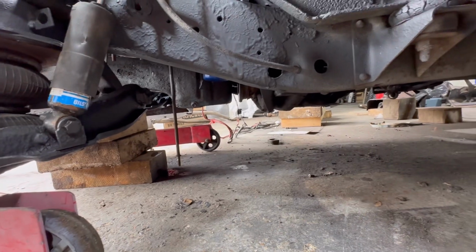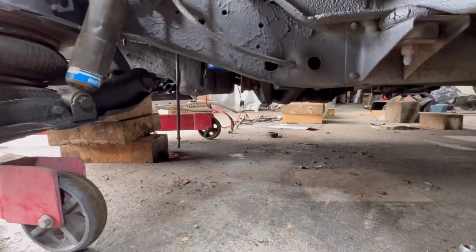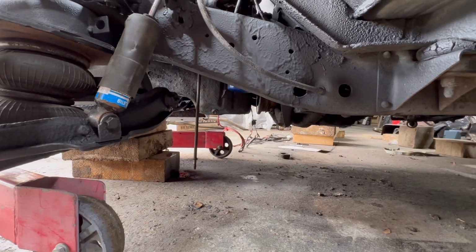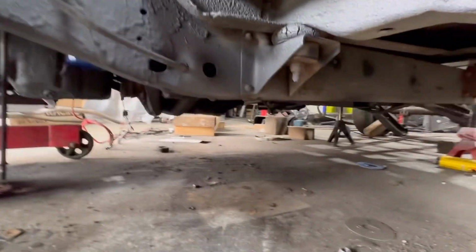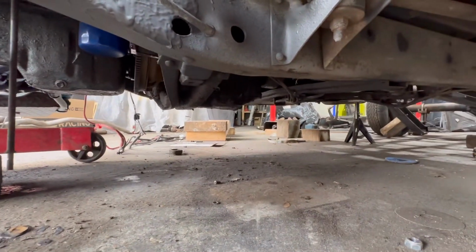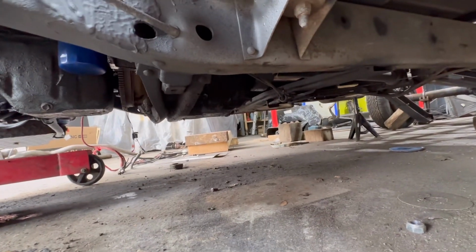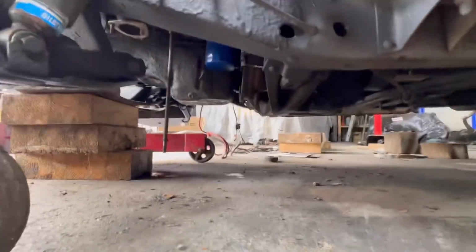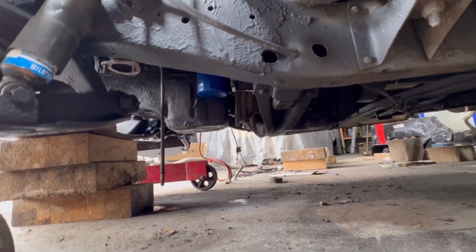The sump is probably level with the chassis rail, so we need everything to be as low or higher than that chassis rail there. Obviously the gearbox and gearbox cradle hang too far down, so we've got to get that. Once on the ramp I could do that, but the engine looks all right, so just a small raise on the engine, clear the pulley, and then we're good to go, I do believe. Right, so we're getting somewhere now.